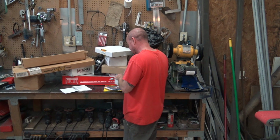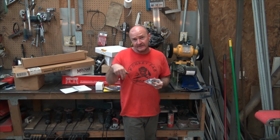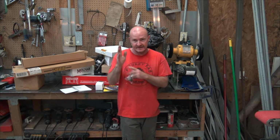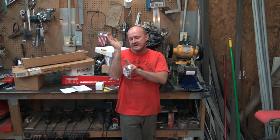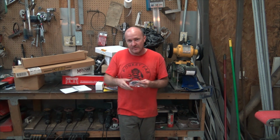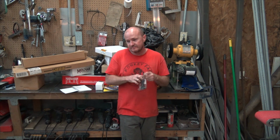I like these guys. I'm not a big fan of the spring-loaded one, I think it's like LS2 or 3, they started making those where it goes beside the chain. What I've seen happen on a few occasions is that the plastic or Teflon, whatever they use to rub up against the chain as a chain guide, breaks, goes right to the oil pan, gets sucked directly into the oil pickup, starves all the bearings, and you have a rod knock. More than one occasion. So you just gotta let the chain flop.